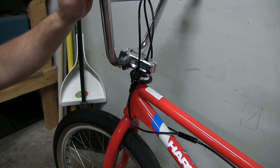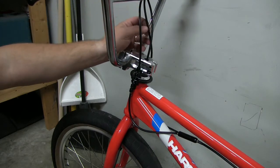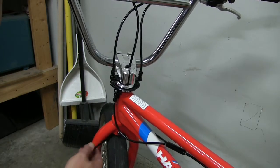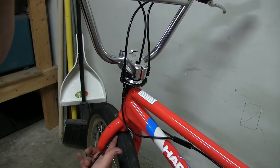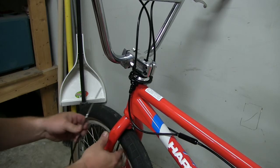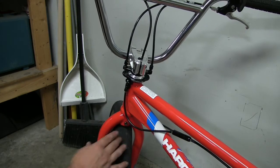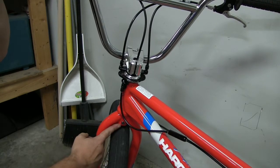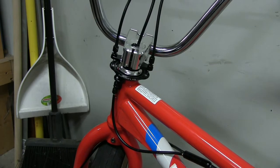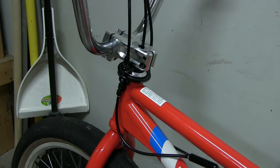We're going to install it into the lever here. What I mean by not ideal — this tire is so fat that the cable is actually rubbing the tire. So I'm going to have to wire tie it up against here, and that's probably going to cause a little bit of resistance. So the cable's installed, and next we're going to move on to the actual front brake. I've drilled out the back of the fork here, and I've installed one of the Haro flush mount nuts on there for a cleaner look.